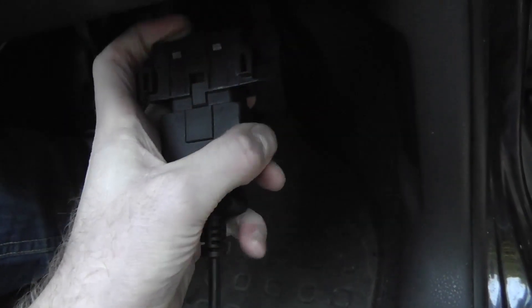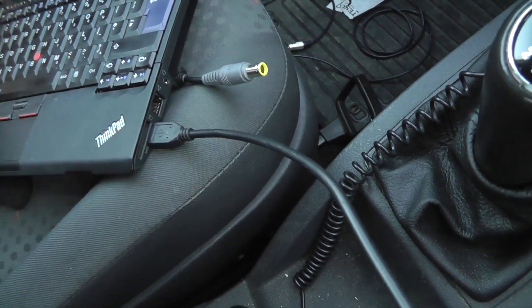Get your flash tool and plug it into the OBD2 port. Plug in and connect that to your laptop. Get your power into your laptop. It's always very tempting not to plug in the power for your laptop because it has a battery, or for your car because the screen says it's got 12 volts - but don't give in to the temptation. If you brick your ECU, it's going to be expensive.